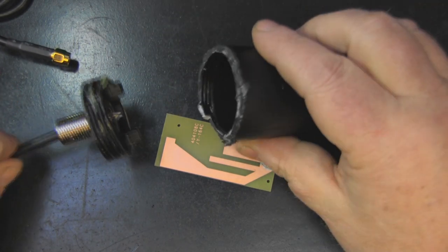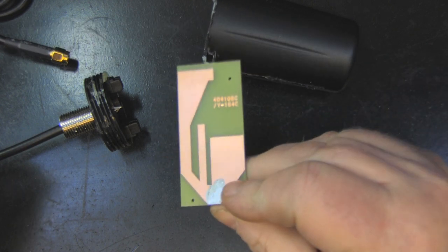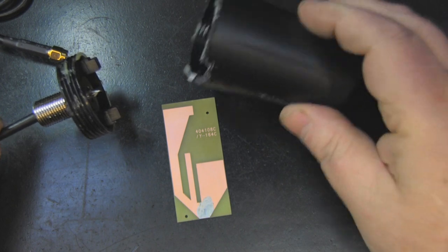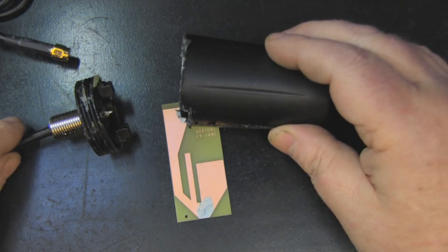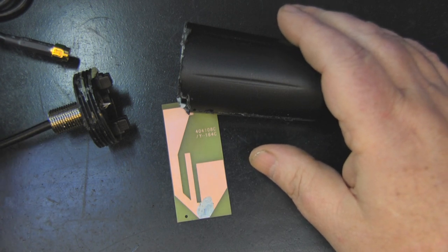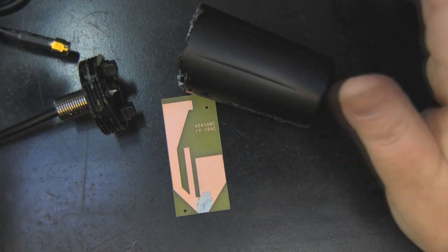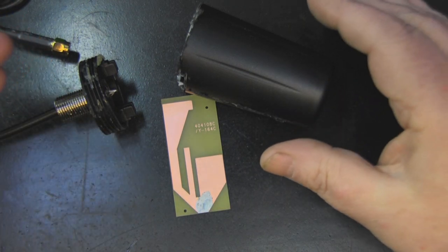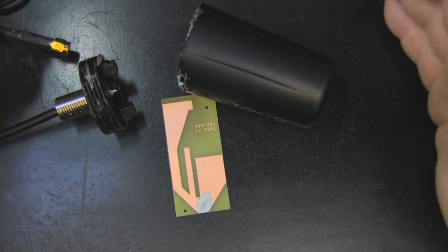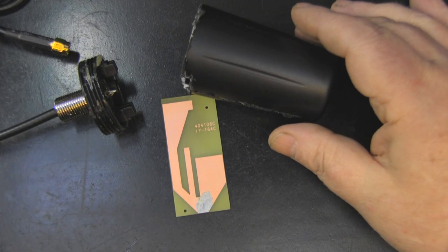Do you really want to mount an antenna with such low gain on the outside of your home? Personally I wouldn't. As an indoor antenna connected to the back of your router it's fine, but I wouldn't permanently mount this outside. If you're going to do that, stick something with at least 6 dB — maybe 8 dB — on the side of your house. I've discussed this on my Facebook group; I don't have a lot of experience with cellular routers as I've had a fiber optic connection since early 2001.